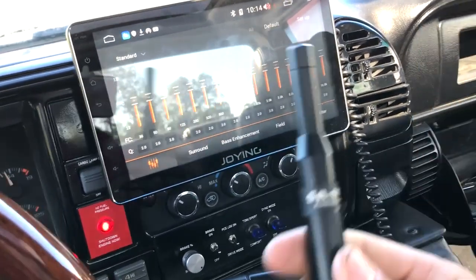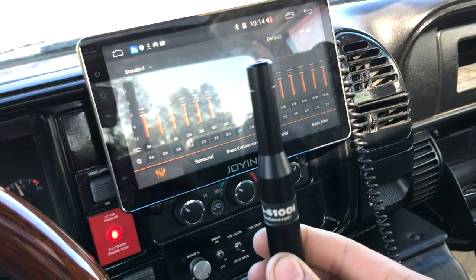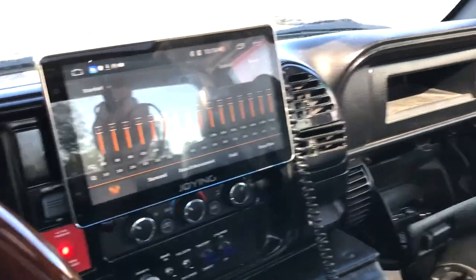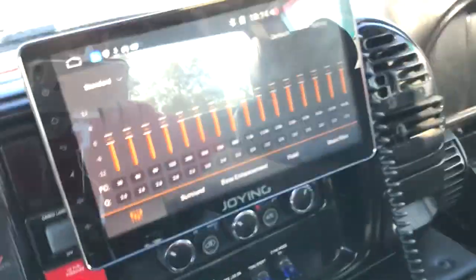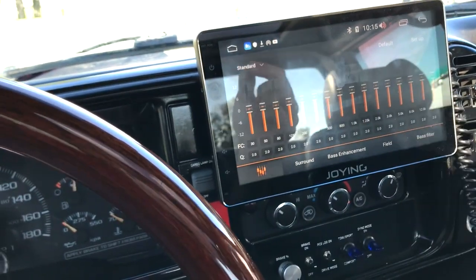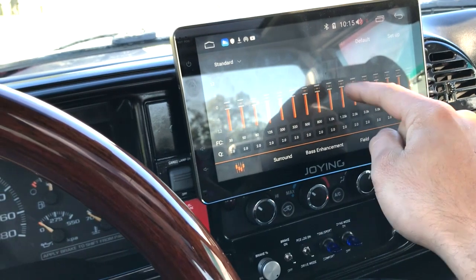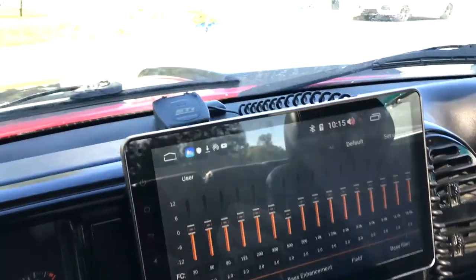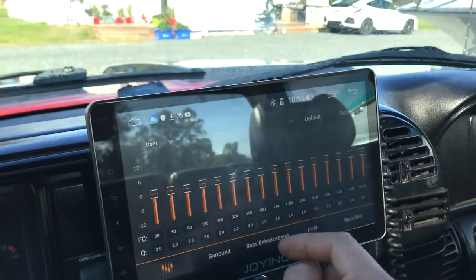Research what an RTA is because it's hard to explain to everyone — what's an RTA, where do I get it. So this is the product number: SA4100i AudioControl. Go on their website and research what it's for. It plugs into the iPhone via a lightning cable. You get the app, put it right where your driver's seat is — there's a microphone — and you play pink noise. Pink noise is all the frequencies at the same decibel level at the same time. When you look at your phone with the app and that microphone, you'll see, for example, 500 Hz is higher than 800 Hz — so you tune 500 down to make it level. Once music gets to your ear, you want everything to arrive at the same level at the same time. You can use that RTA to do that.